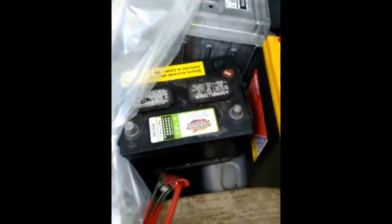I was looking locally for another one and couldn't find it easily. If it had been a standard flooded lead acid battery, I would have absolutely brought it back 100%. I was giving up a little easier than I normally would because it's AGM. The AGM battery isn't so much a different chemistry as a different format for more or less the same chemistry, and the theory of sulfation doesn't apply quite as much because everything's in a gel format.